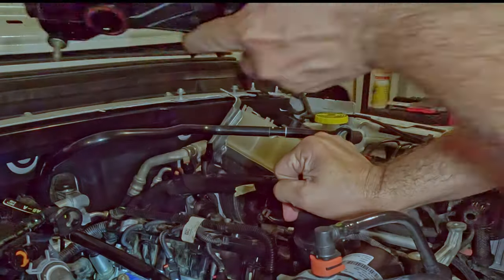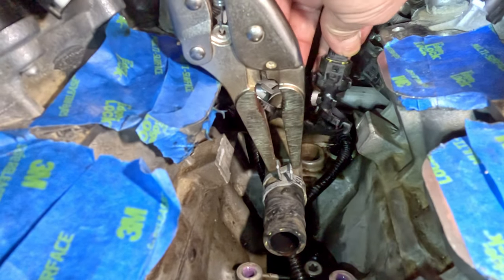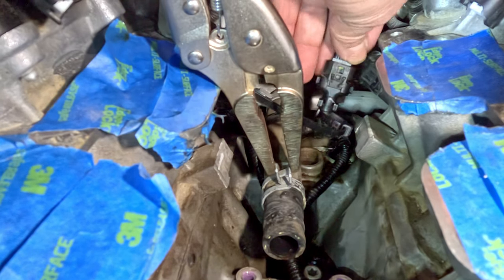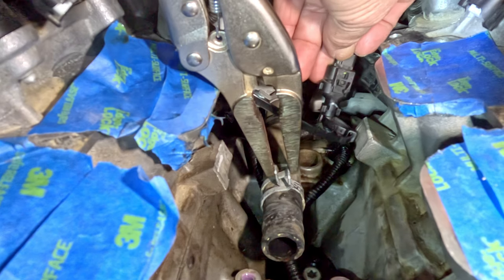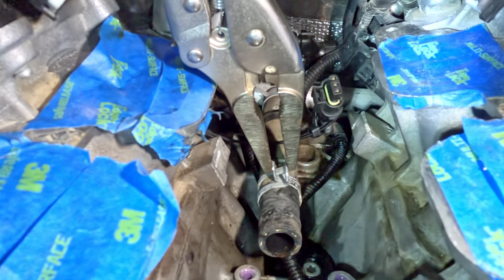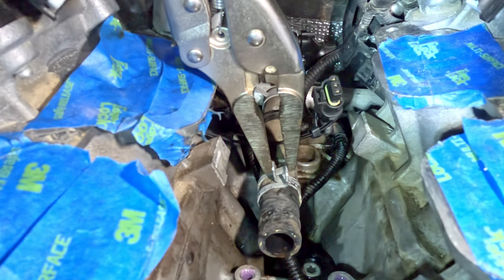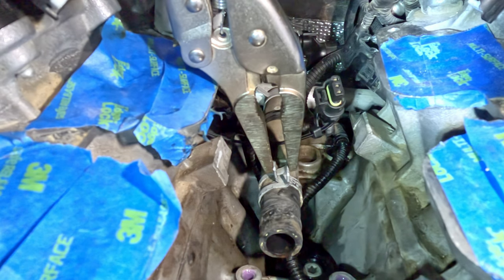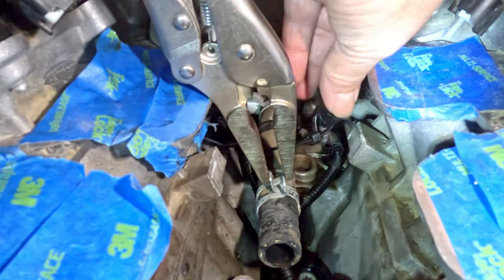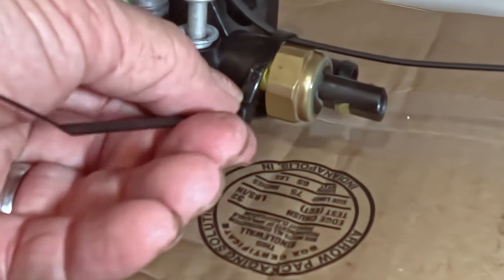There's the oil cooler oil filter housing. I did break the connector, but there's no way I'm going to cut and splice anything with electronics this sensitive — this is still serviceable. I want to note that these are special zip ties rated to 248 degrees. Most common zip ties are rated to 185 degrees. I found these at Home Depot and they are rated for automotive use.